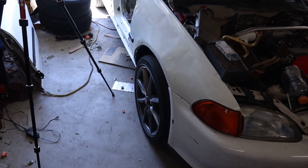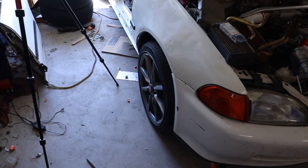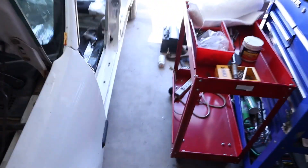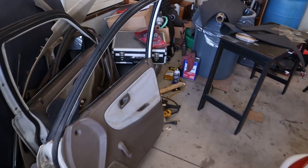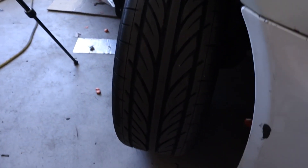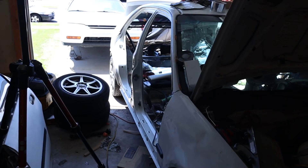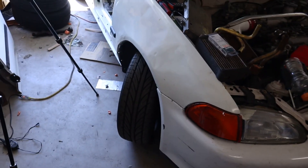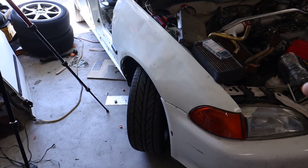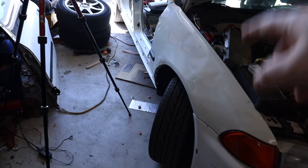At one point I had 15-inch Civic Si wheels from this era and they did fine, but 15-inch tires in a style I like are getting harder to find because OEMs are all moving to bigger wheels. I'm particular about my tread design — I like moderately aggressive directional tires. They help with grip, not always in the wet, but these do have rain channels. I prefer a Toyo T1R, but they don't make them in this size, and going up a size would interfere with the front fender and inner wheel wells.